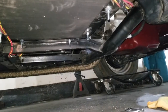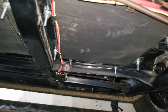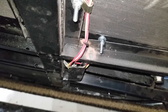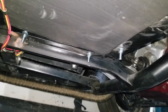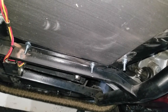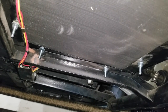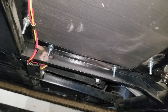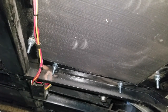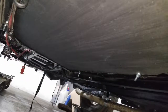Enjoy. And I forgot to show some other areas here. The underside, I got a couple of touch-up areas where I elected to cut off the captive bolt and just go with nylocks. And I use 7/16 by 1, I think it is. This dark stuff on the back of the floors is what's called lizard skin. I've mentioned that in a prior video. This is a ceramic coating that rebuffs heat. It also coats the wood. Prior to putting that stuff on, though, I dunked all of these floorboards in a ton of weather sealant.